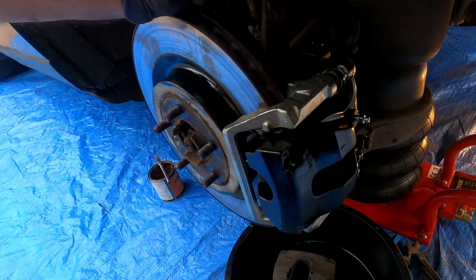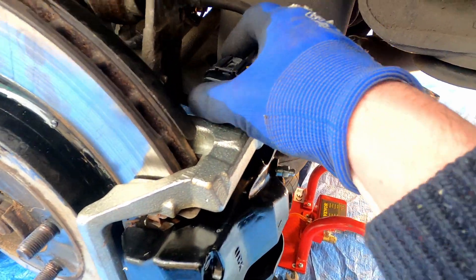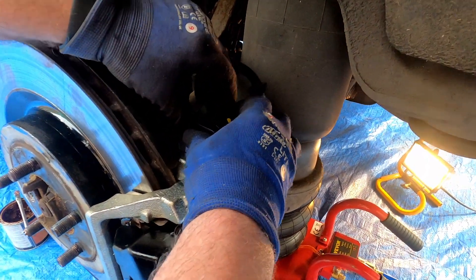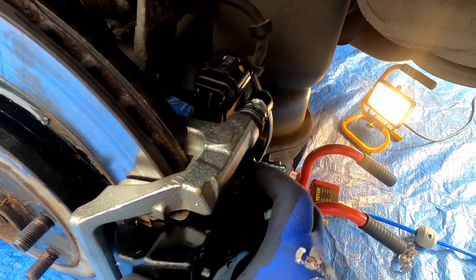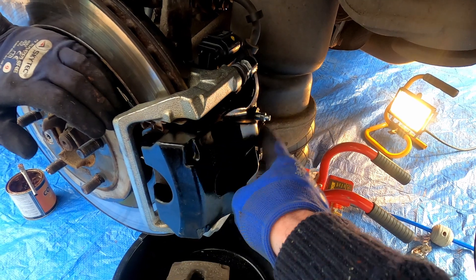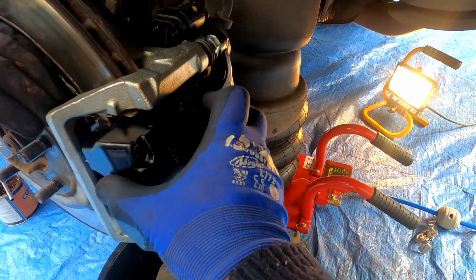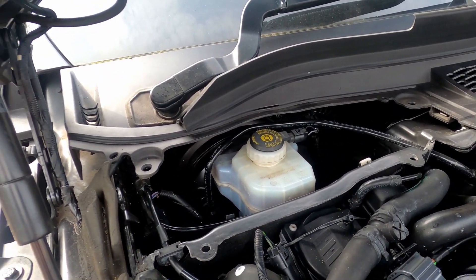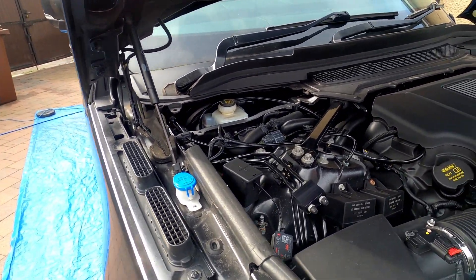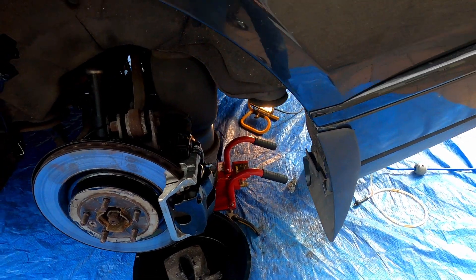Let's have a wee look around the other side. We need to put the left protection on. Caliper looks fine. The electrical connection is up here - we can click that in there. Good slider pins. So what we'll do next is bleed the brakes and check for leaks, then we'll test it before we move onto the next one, because we know the other one's a known working one. Now that we've got the caliper on, we're going to bleed the brake, but also flush the brake system while we're at it. We're going to take all the fluid from the reservoir and flush it as per usual procedure with our vacuum hose.